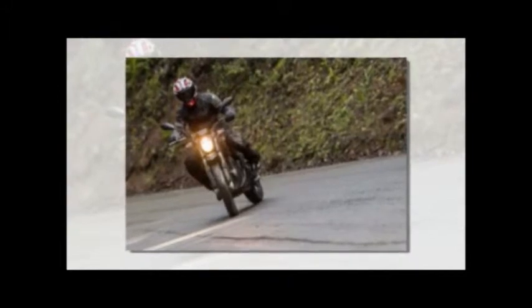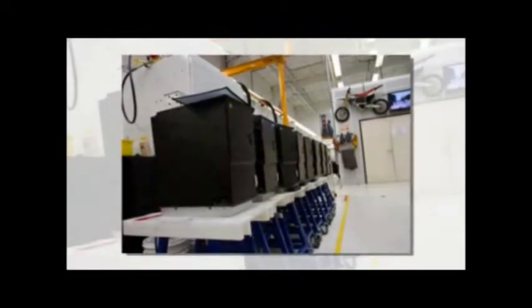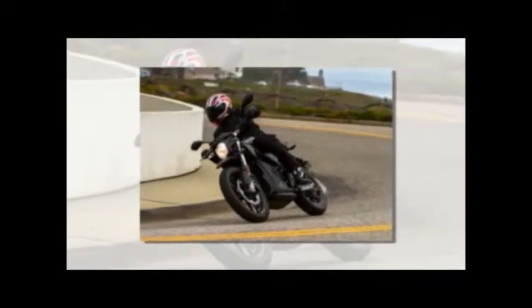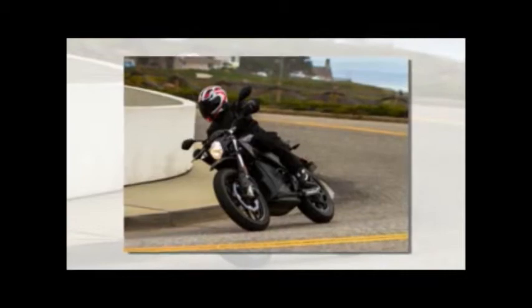I will say, though, that hard braking over bumpy pavement is enough to confuse the system into activating, a situation I learned to remedy by applying the brakes earlier and with less force. Other than that, the single 320mm petal disc, twin piston caliper and steel braided line provided impressive stopping power and feel. Even the rear brake, which was an on/off switch in the past, now has a reasonable amount of feel at the lever.